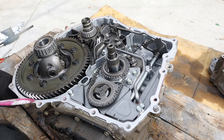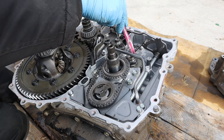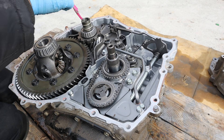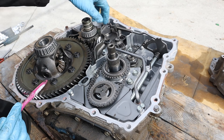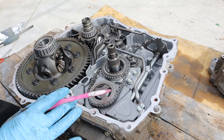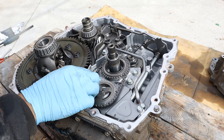Taking a look inside this continuously variable transmission, you can see this here is the input, and the final drive over here would be your output. These are a countershaft which is going to send power out to the first variator, and then the second variator with the belt behind here. Over here there's a toothed gear which is going to send signals for your output speed sensor, which is on the casing. Also on the casing is the parking pawl mechanism, which engages with this manual valve over here. Everything is hydraulically controlled, and you have a hydraulic line skipping across over here. The oil pump drive over here is chain driven.